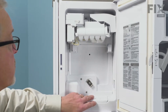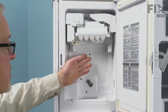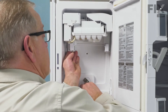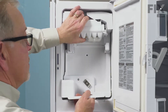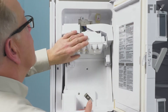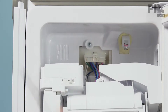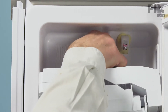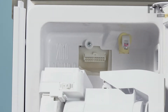With the screws removed and the one at the top loosened, we're next going to lift up on the whole assembly. Make sure that we lift up and out on the bottom and also press up on the top. Once it's freed at the bottom, you'll be able to tilt it down just slightly. Then we'll depress the locking tab to release that wire harness. You need to support the whole assembly so that it doesn't drop out.